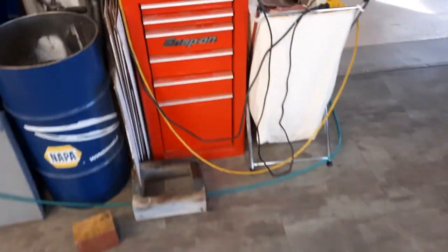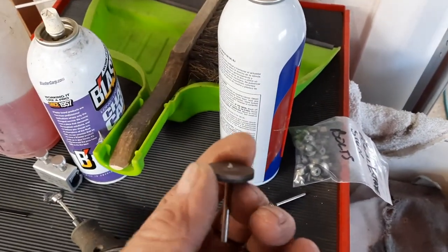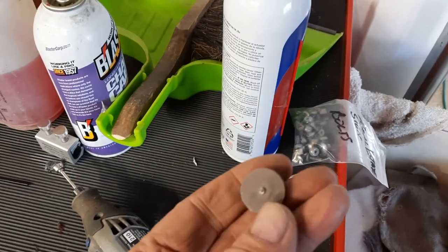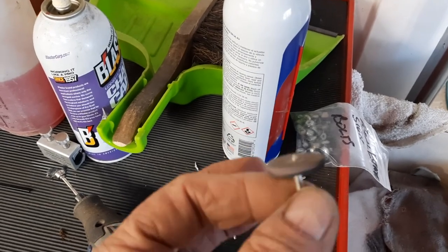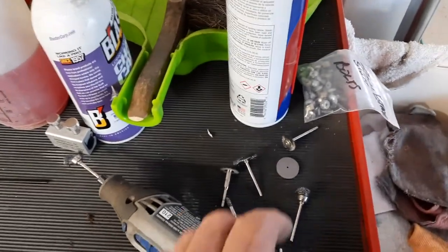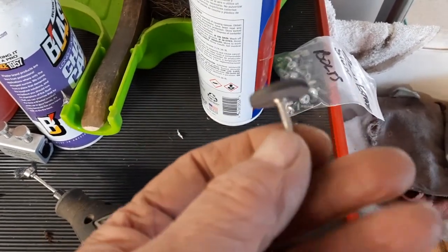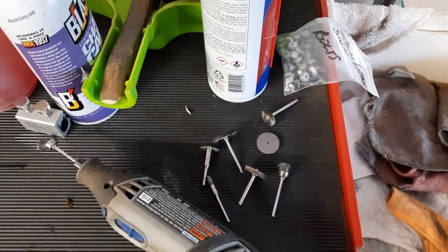Before I go there I'm going to show you the little wheel - it's kind of like a ceramic wheel. I learned about that on brake cylinders - you know, front and rear disc cylinders. They get corroded inside and these little wheels will just polish the metal so that your brake piston will travel back and forth again.